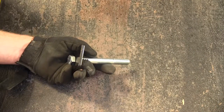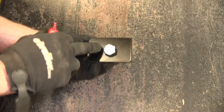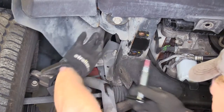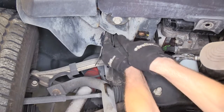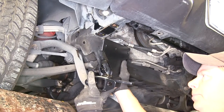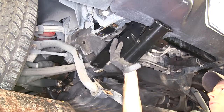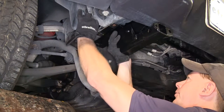At this point, our H3 is ready to install the base plate hardware. We have a 4½-inch long bolt and a 2x3 plate. We're also going to add some red Loctite to it and get it ready to install. Pull back the fender liner, take our bolt, run it through the opening here — it's right next to the body mount — and now through the frame. Now we can go ahead and put one of the receiver braces up into place; this is the one for the passenger side. We'll tilt this corner up into the frame like this and then rotate it up alongside the frame. We'll pull this bolt back out just a little bit and then run it through the brace on the other side.